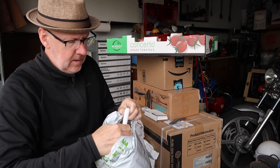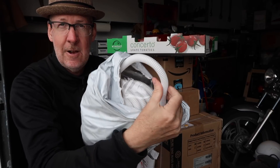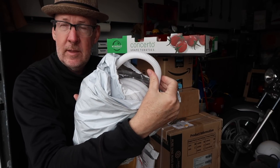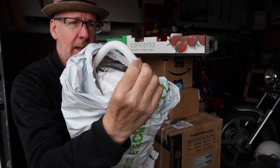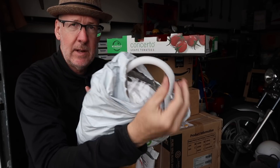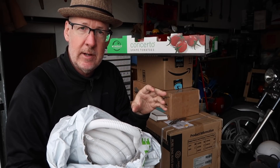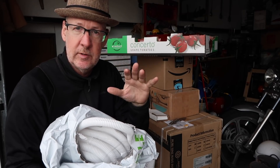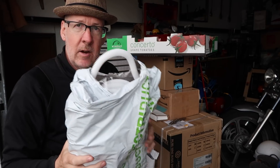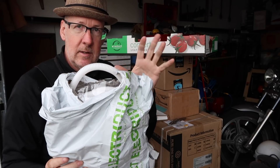I have some conduit holder to protect the wires — I went ahead and got white. My step van right now has wiring that goes inside split tubes so you can run wires in anywhere, and I have black right now. My plan is to use black for anything dealing with the engine and engine batteries — the stock electrical system — and anything running off the new solar setup and house batteries will go in white so I can easily distinguish between the two.